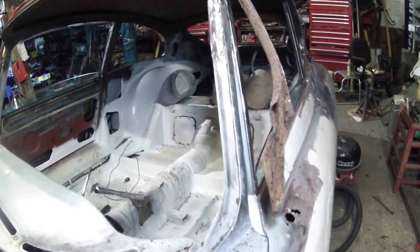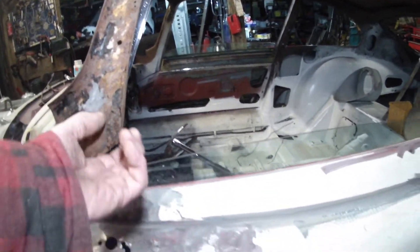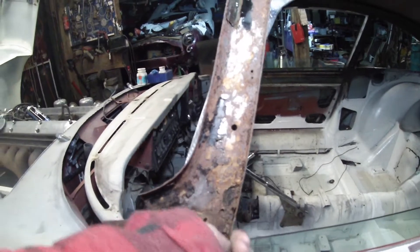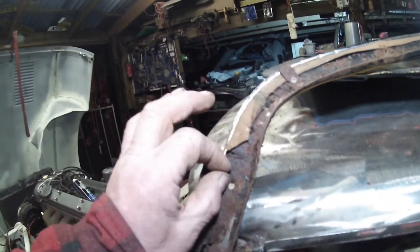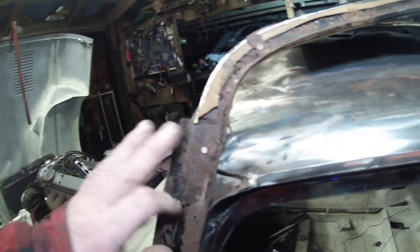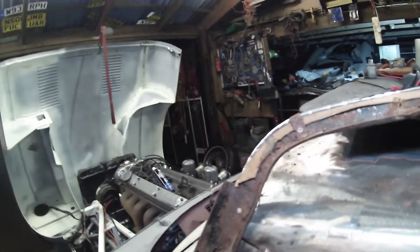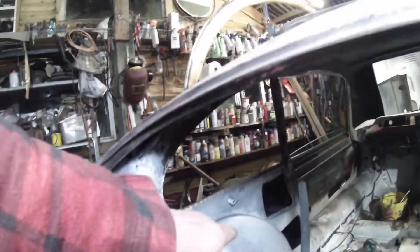The rest of it, we are really doing pretty good with, to be honest. The door cards do need a good de-rusting and skinning off. Then I will trim — I've got a whole roll of black vinyl in the house, which my ex-trimmer left because I'd paid for it. So I'm going to re-trim. I've got plenty of vinyl — I don't like the colour of it, it's a bit too bright, but I will re-trim all this. I'll grind it off with a wire wheel, and I will re-trim those in black, and I'll do that one in black, and the rest of the interior's going in black. The two quarters — we've got a bit of sewing to do on the quarter panel.